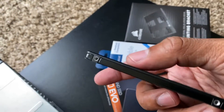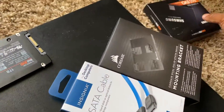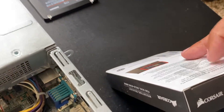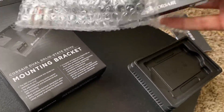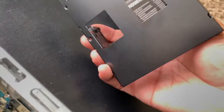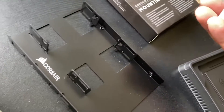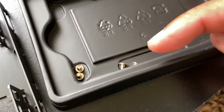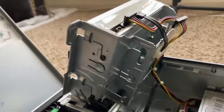You have your power connector and your motherboard connector. See how this has screws on the side — we're going to lay it on the mounting bracket. I took the bracket out. The package comes with big screws and smaller screws — the smaller ones attach the SSD to the bracket, and the big screws go on the outside so you can slide it into the bay.